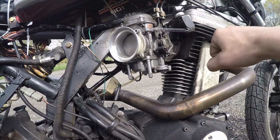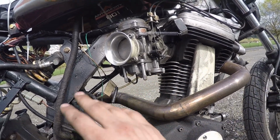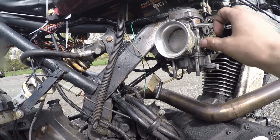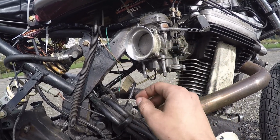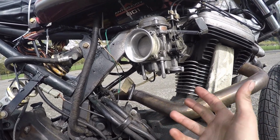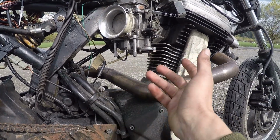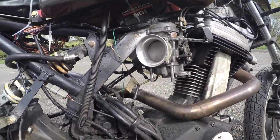So that just means that when you open up the throttle, at first it'll give a shot of gas directly into the intake. Without that, on the stock carb and on a lot of engines, there's a small problem: when you grab some gas, the throttle opens up and there's a rush of cold air going in, which is fine. But it takes a second for the gas to even out into a good mixture again, so the fuel mixture gets a little bit lean when you pump that throttle. But with the accelerator pump, you don't have that problem as much. In this case, it's not at all, probably. In fact, it probably spits in a bit too much gas, to be honest.